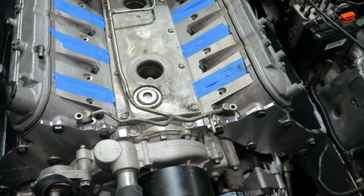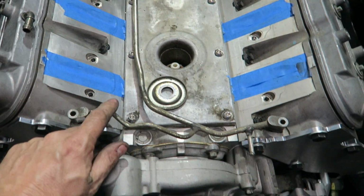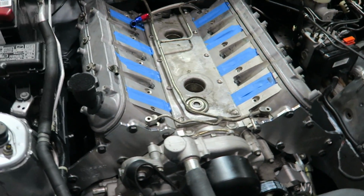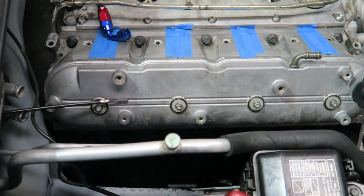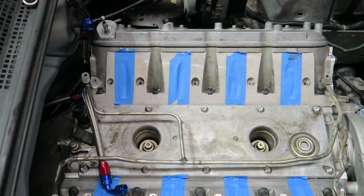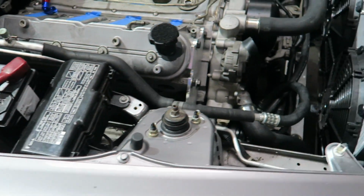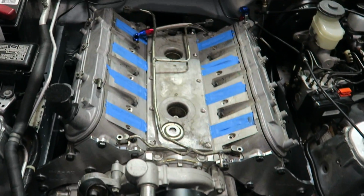The steam pipe here was from a Corvette, and it's not drilled on the back head, so we have to modify this to work for the Camaro, or buy another one for a Camaro. Heater lines have to be put on. Coils have to be done. Again, wiring harness, we can't put the intake manifold on or this header until we have the wiring harness. But we're looking pretty good. It's coming along and it looks quite good. It fits in there nice.